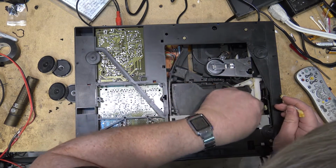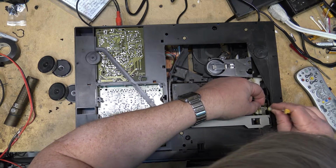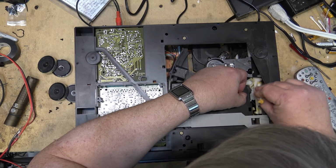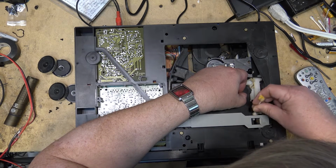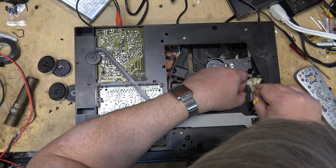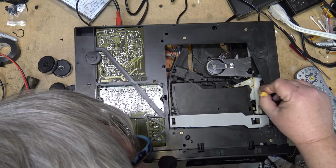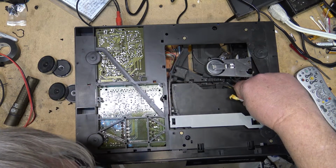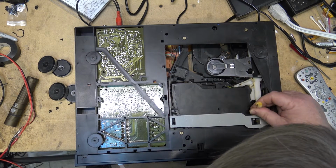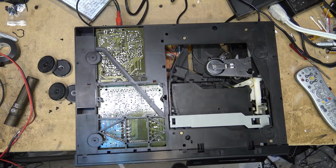That grease was pretty tacky. When I wiped it in my fingers, it was not very slippery. It almost felt like a wax. It had become quite gooey and sticky. That's what happened on a lot of old VCRs, right? That black molybdenum crap that would dry up, and the grease that was used on the old dual turntables, exactly the same, where it would get gummed up and then the mechanism would stick. So whenever you see this old dried grease, you've got to get rid of it and lubricate it again with plastic safe lubricant, of course.